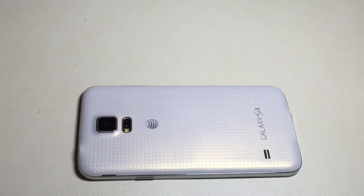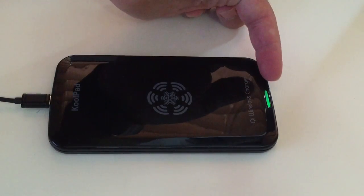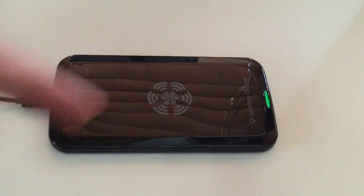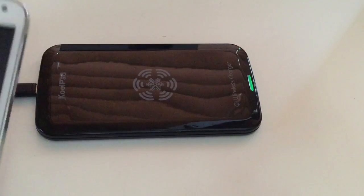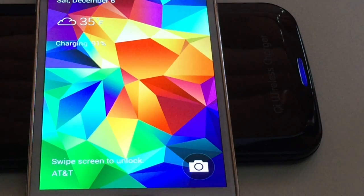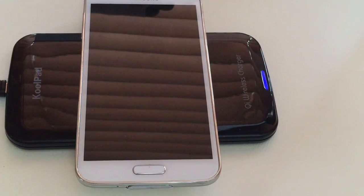Now that we've installed it — and you saw how quick that is — let's go ahead and put it on a charging plate so we can see how it charges. Here I have my charging pad and you'll notice that the LED is green. This is the area also known as the sweet spot for charging, that's why you have that little symbol there. What you want to do is get the coil that we installed to line up with this. I find it's a little bit more difficult vertically, so I like putting it landscape. I'm going to take my phone now that has the coil on it and just place it until I see the light turn on. You'll notice it says on the screen that wireless charging has been enabled and the charging symbol is on as well, and the LED for the actual charger has changed from green to that deep blue. And that's all it takes to convert or upgrade your Galaxy S5 to a wireless charging Galaxy S5.